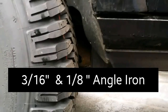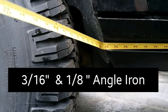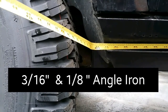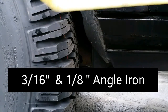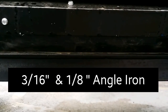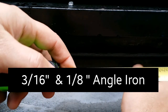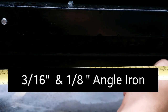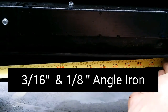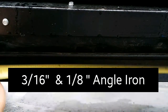I'll show you my measurements. Okay, pulling from the long side of a 30-degree bevel, overall length is 71 inches to the other long side of a 30-degree bevel. Again, 71 if you can't see that. Now, about 2/3 of the way down, there's a notch right here. You might have seen it in the first video I made, but there's a notch from about 38 inches. The notch goes all the way to 53 inches.